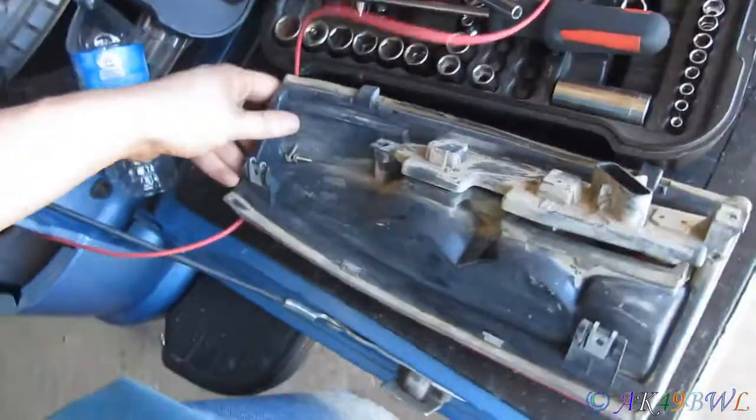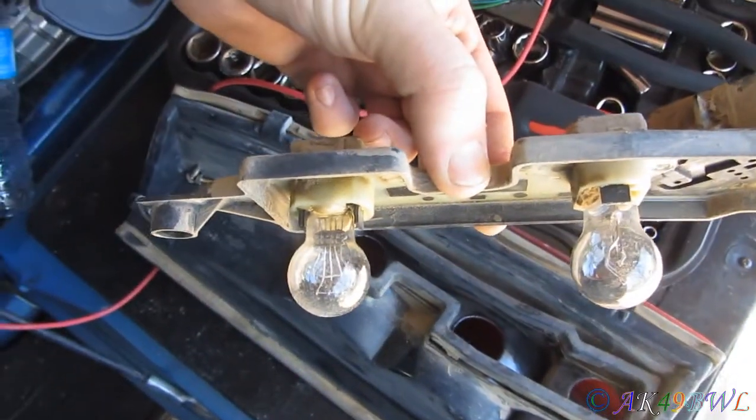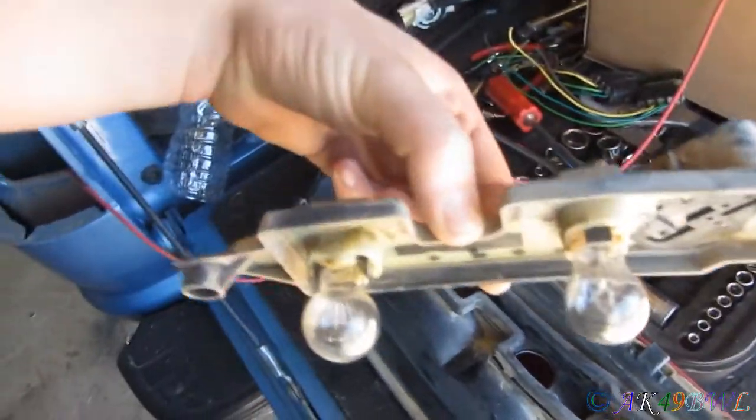I just don't feel good running a straight wire off the brake switch straight to power lights. I'm sure the wiring can handle it, especially if it's gonna be LEDs, but better safe than sorry. Especially if I do figure out a way to modify these tail lights so that I can have both of these upper bulbs do the same thing. Or better yet what I would really love to do is have the upper bulb be the blinker and the bottom bulbs just be the brakes. I would love that.